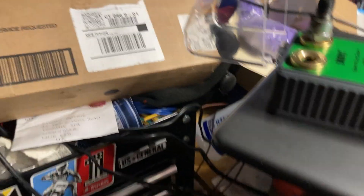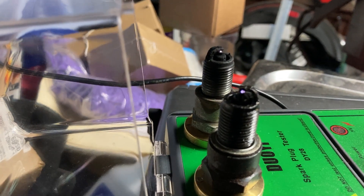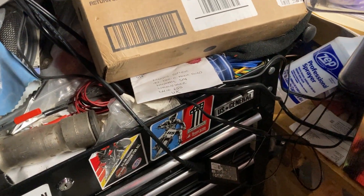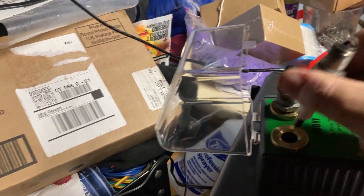What else we got in here? Oh, here's another torch - let's try it. Yeah, looks like it's working, but I guarantee when I took it out it wasn't working. One thing I found on the torch plugs: they're not consistent. You'll get spark but sometimes it's not a consistent spark. Another torch - that one looks pretty good, nice blue spark. And I'll be honest, my friend Roy in the UK loves the torch plugs and never has a problem, and that's okay.